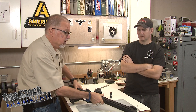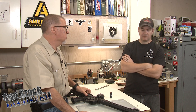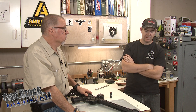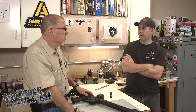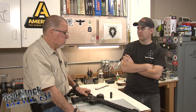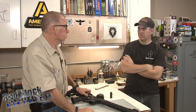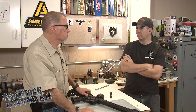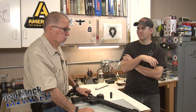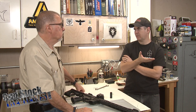Marty, give me the pros and cons of using an aluminum brake on anything. Well, the pro is it's a little lighter weight. The bigger con is that they heat up quicker — they go through a lot more dramatic thermal expansion compared to steel. So you could have tolerances loosen up. The steel is going to expand at a different rate than the aluminum, so in theory the material could yield quicker and has the potential to loosen up.